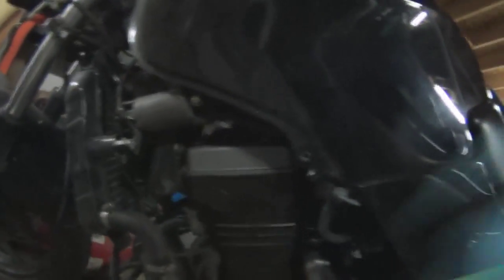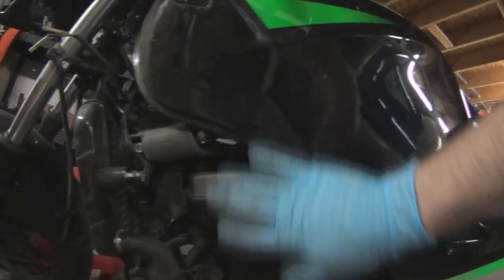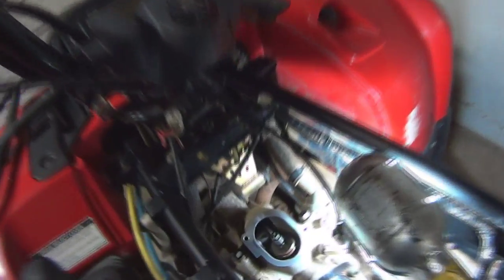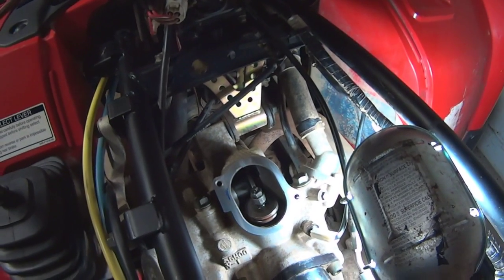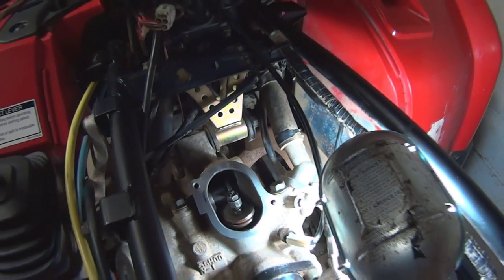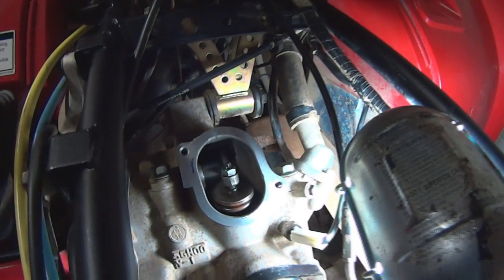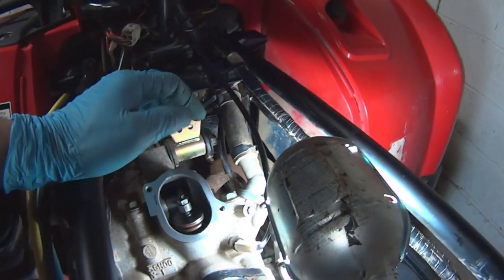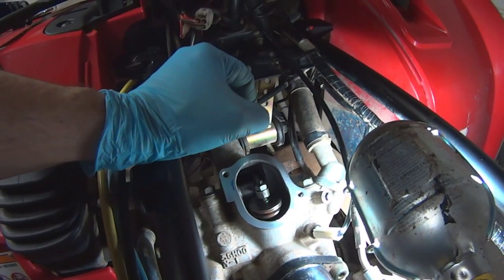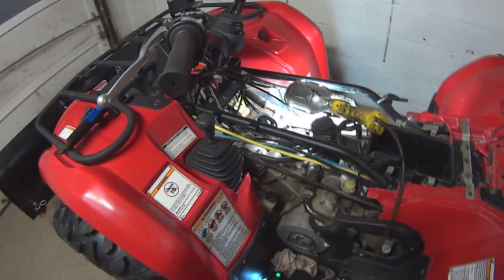Compared to this thing — the only time you spend is taking this tank and all the side panels off, which is just a couple bolts here and there. It's such an easy job. I love Yamaha for that — they make it easy because that's something you've got to do. Sadly, most people will never do it; they just ride those quads till they destroy the engine and never think about adjusting the valves. This one is at 1,300 miles and I put it on the high side, so I think it's going to be good till about four or five thousand miles, which is a lot for a quad.